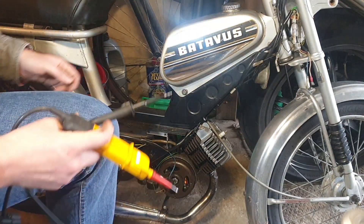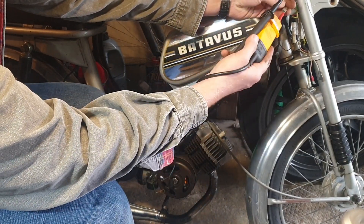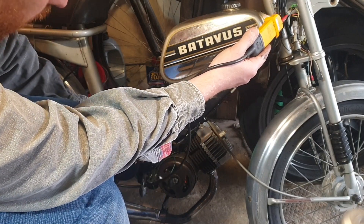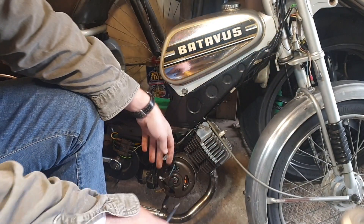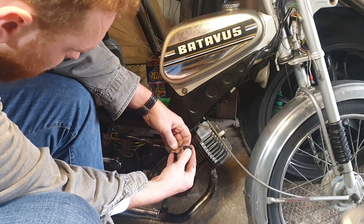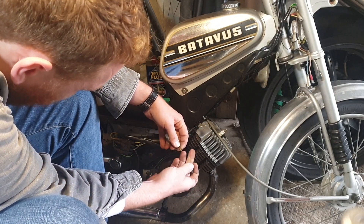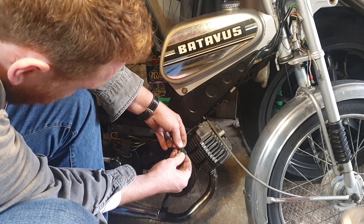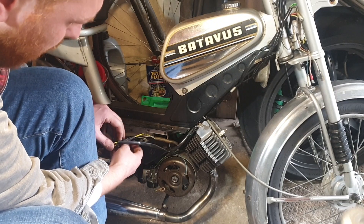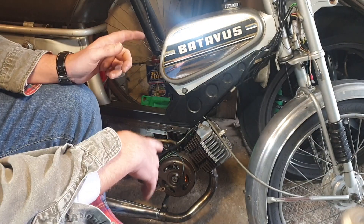I just want to make sure it's not a dead short down the switch line - so that's that feed there. Goes up to the switch and back, fixed up to the frame - yeah, it's all working. And that comes from here. Now this looks really rough - this is a really nasty connector, just bad. I might re-crimp that myself in a bit, leave it for now. All of this is working - I think this is all power stuff. I'm just interested in getting the spark out of this thing.